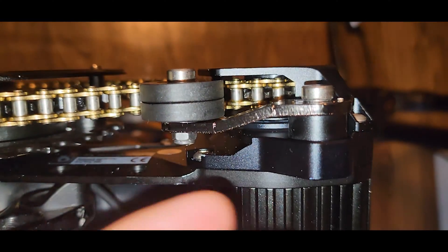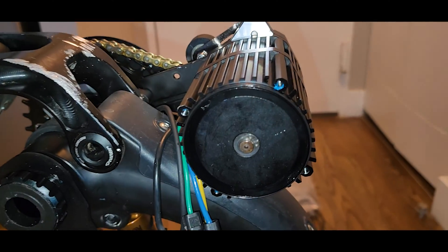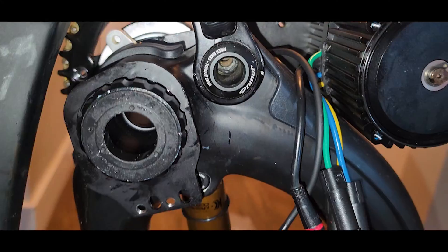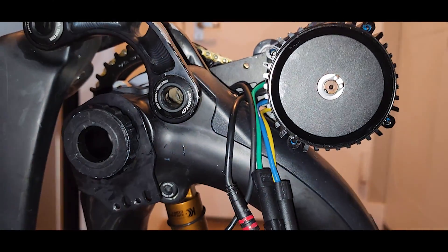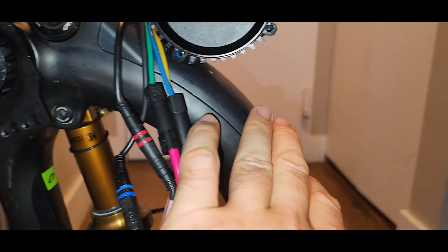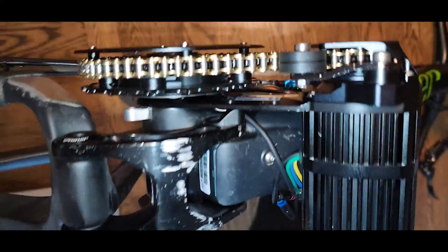Because you have the cover on top, so it's all going to splash away, and from the bottom gravity is not going to get in there unless you really submerge it. The cover goes on top and it's perfectly machined. So it is maybe not completely waterproof, but it's water resistant, very well sealed and protected. My cage for the controller does not fit here because of the frame, and I'll have to connect the controller somewhere so it doesn't sit in the way — maybe in the front placed in front of the battery or maybe inside the triangle. But it's a very easy and very fast process to install.